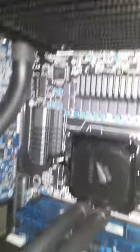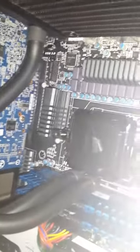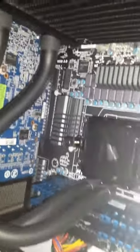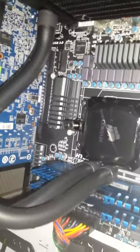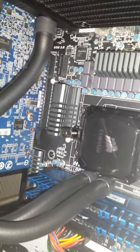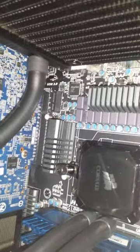Now for the inside — two big things have changed. As you can see, I got water cooling now for my AMD FX6300. I actually got it overclocked to 4.20 GHz and I'm still never seeing above 36, 37 Celsius. AMD runs hot anyway — I think the max temp for this chip is 61 Celsius, so running at 37 is awesome. Maybe I'll up it a little bit more, but there's really no need. It's the Corsair H60.